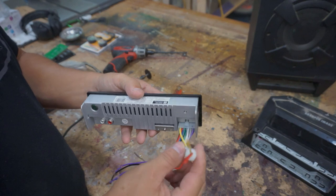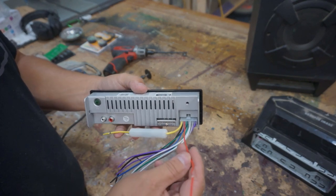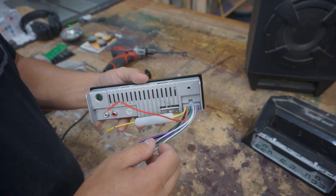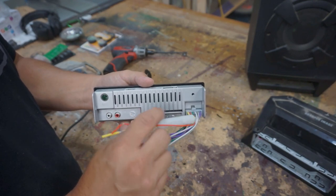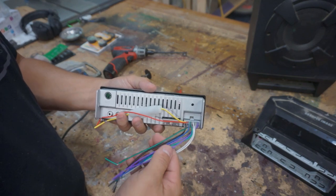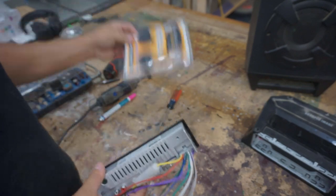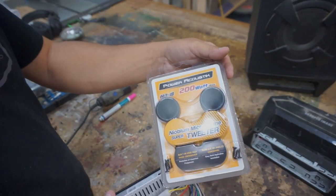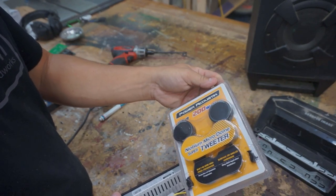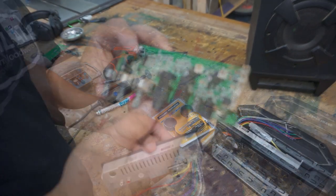We're not going to use all of the wires. The yellow is the main power — you hook that up to your 12 volts. The red is for an ignition switch and needs to sense power, like when you're turning on. Since we don't have a switch, we're just going to hotwire those together with the power. The wire colors indicate how your speakers hook up. I also found these cheap little tweeters for about seven bucks — I just wanted to test them out, so we'll hook those up to the rear wires.